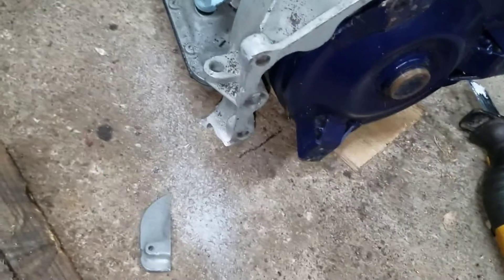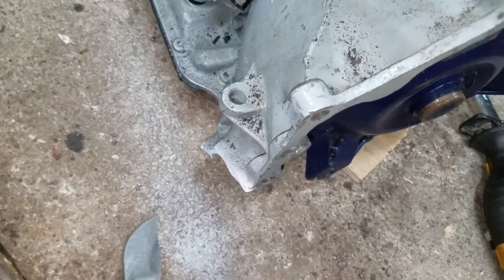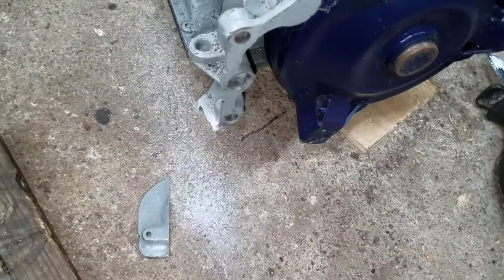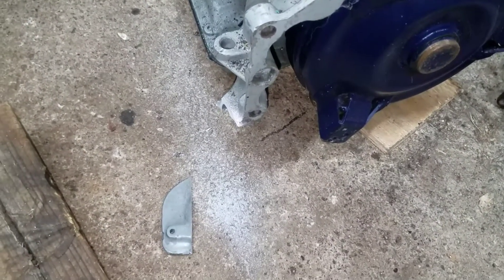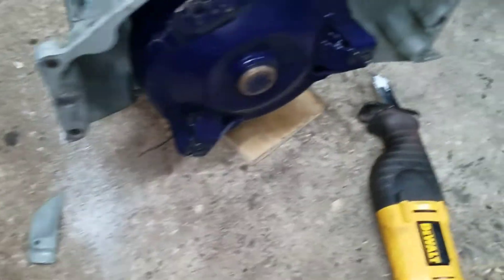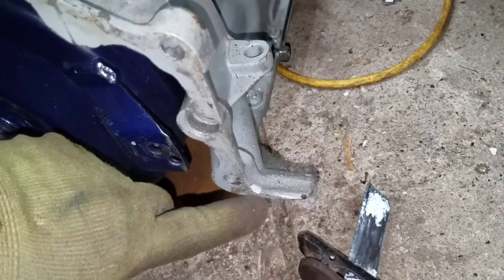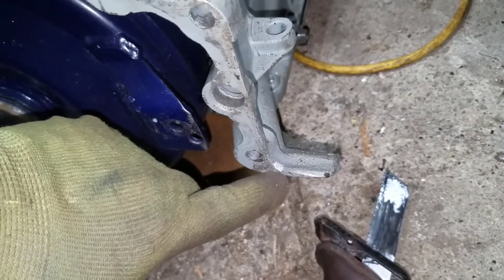This is for the El Camino big block build, and I'm just cutting the ears off this transmission for the headers. I'm going to put them on so I can take the transmission in and out. I cut this one, and then I looked on YouTube and I don't see one single video on this. So we'll just cut the other one. I'll use a sawzall, cutting right next to where you've got your mounting bolt at the back of the engine.